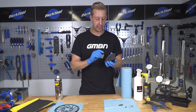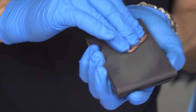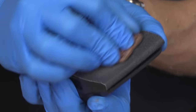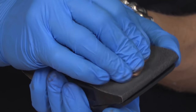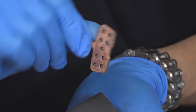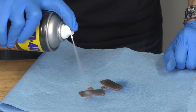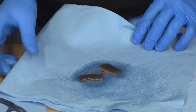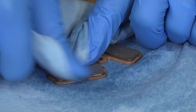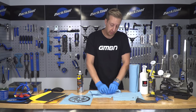Your next step is to get the pads onto the block with the sandpaper in place and give them a good rubbing down — you just want to make sure there's no chance of any of that residue still being on there. By doing this, and doing the same to the disc rotors, you create a surface that's going to mate really well together and allow you to bed in your brakes so they work perfectly. Once you're happy it's been cleaned and scrubbed down on the sandpaper block, give it a final clean, set it aside for reinstallation, then do exactly the same process on the other pad. Make sure any pad material that's come off on the sanding block is removed, give both pads a final clean, and set them aside to completely dry out.